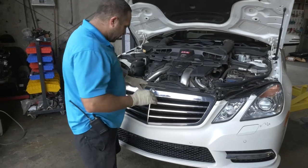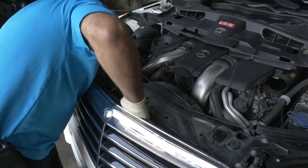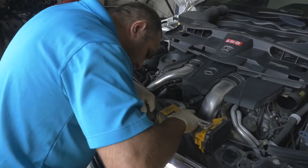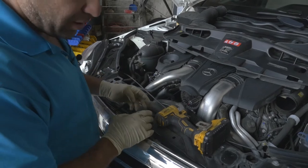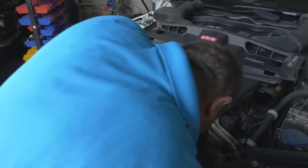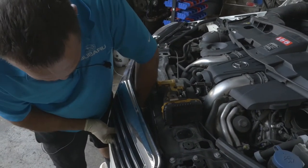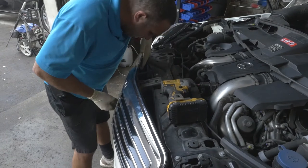The grille — let's see how to remove the grille. From what I see here, that 10mm bolt's got to go. I'm going to put this 10 back into the spot. Looks like there's some tabs down here for the grille — you've got to kind of push down on them and pull at the same time, and they'll pop out. That's four of them.